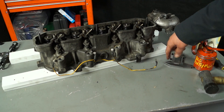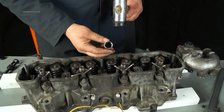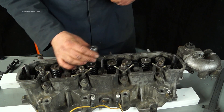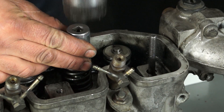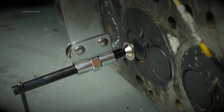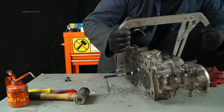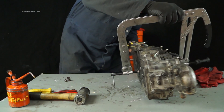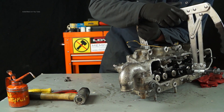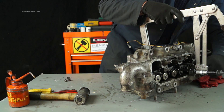Initially you need to put your cylinder head on some blocks of wood, then using a socket, tap the spring cup down so you've jarred the collets loose slightly from the valve. Use a longer socket if you like. Depending on what cylinder head you have — I have a 300TDI one here — you want to place this part onto the valve squarely so it's in the center. This tool has a lever action, and if you find it hard to push into position, slacken off the threaded part first. You don't have to use the lever to push the valve spring down. Get it in position so it's nice and square on the spring cup of the valve.